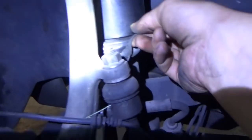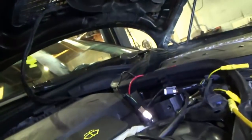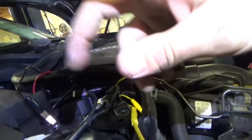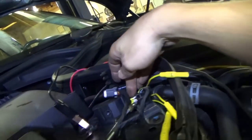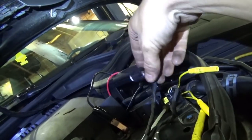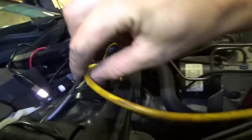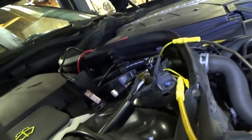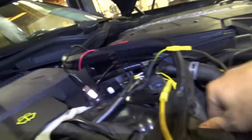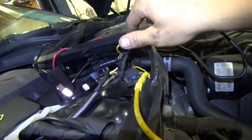Right here this bellows was ripped up, so we kind of opened it up to see. We can hear the leak but we couldn't really see where it was coming from. What you can do is take power and ground the middle pin in here — it's a three-wire actuator, so unplug the computer side, don't mess with that, and just hook up direct power and ground to the valve and you'll hear it click right there.